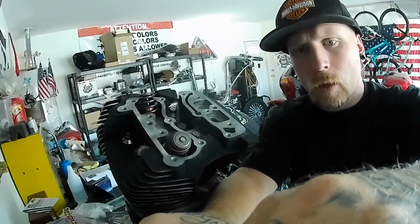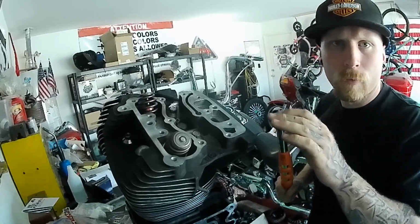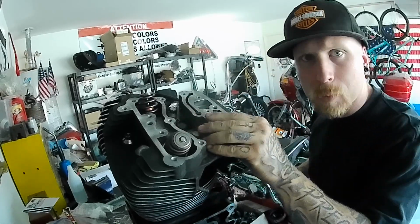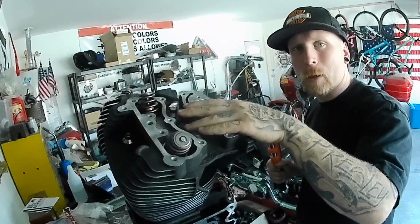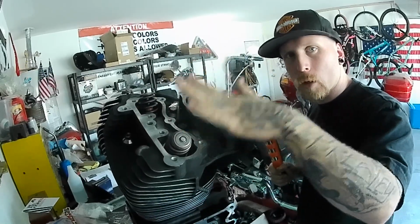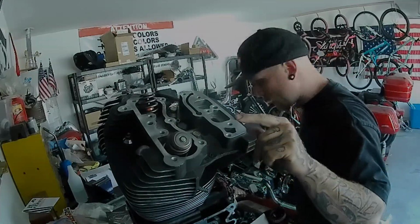That mic can hear me. I'm gonna tighten up this cylinder head on camera, following the bolt pattern, the sequence pattern in the book. I've already done the front one. I'm going to step back to the rear, and I'll increase my torque, and I'll do the final torque just on the rear head for you guys to see, because that's the easiest film angle that I got.